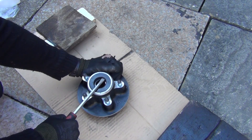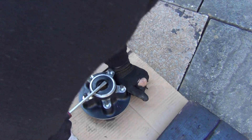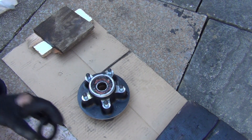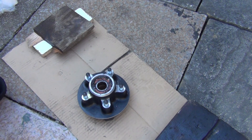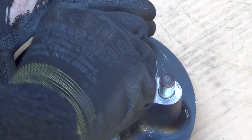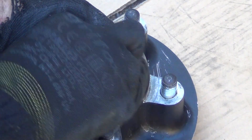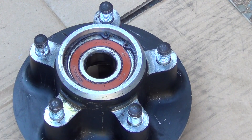Here's another one for us. First of all, we've got to remove this seal. Slight motivation with the screwdriver and it comes out. Then inside you're going to see there's going to be a circlip. So let me just get this grease away from there. Let's try to remove it — snap ring pliers.